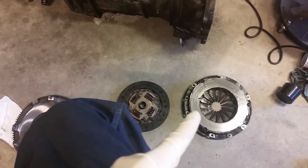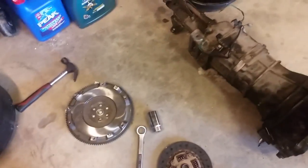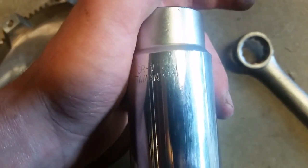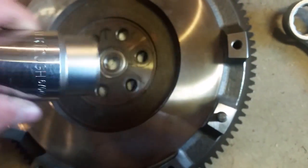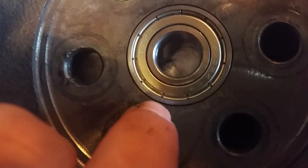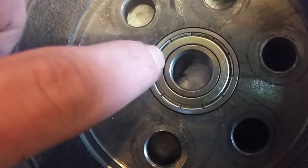Make sure you use your clutch alignment tool — that's important. I got that installed. This is a 34mm socket. You take this end, put it down over the bearing, and tap here, here, here with a hammer until it's seated. This is bigger than the diameter — you want to be hitting this outer metal rim, not the dust cover or the inside. Don't hit the inside or you'll ruin the bearing.